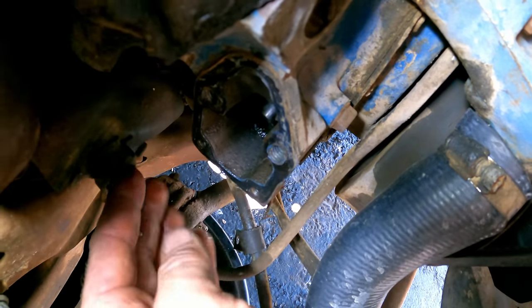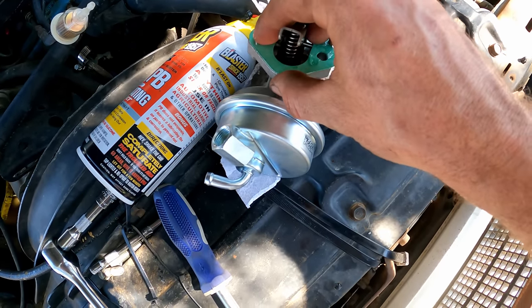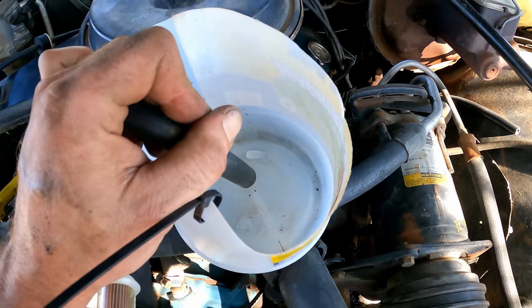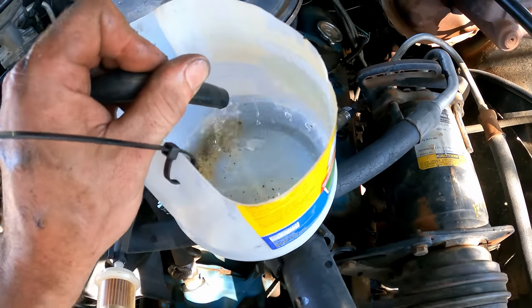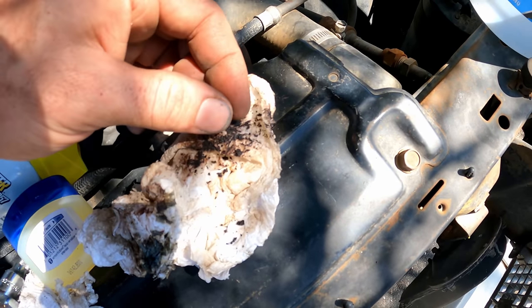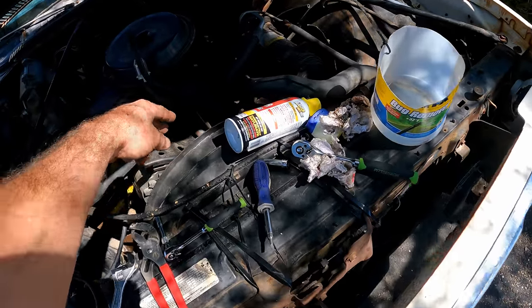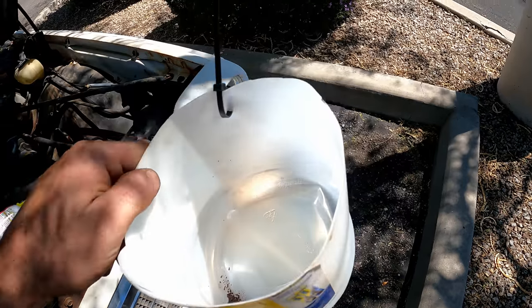There it is - hopefully that holds! Vaseline still comes in handy for holding the gasket in place. Go ahead and drop the pump into place - bolts are in. Let's flow test this - go ahead, crank it. Oh yeah, and there comes more crud - so maybe that junk is all in the lines. That's some more flushing of the line - this is the stuff coming out: a black almost rubbery sludge. And what came out that time is definitely rust flakes, probably due to me re-bending the hard line to make it work on that pump.